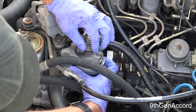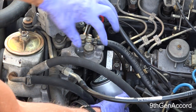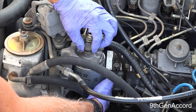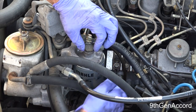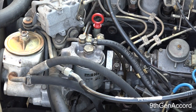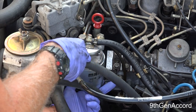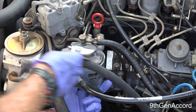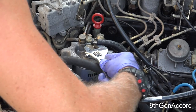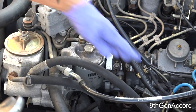I'll go ahead and put the filter back up here. If you're having trouble getting this on because it can be a little tight, if you lift the bolt up just a little bit and then start it that way, you can feel it engaging the threads. If you don't have it at the perfect angle you'll fight with it because there's just not a lot of clearance here. Once I get it pretty much hand tight, I'm going to hold the filter and just snug the bolt up — just like that. That's perfect.